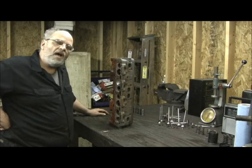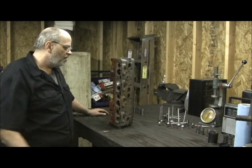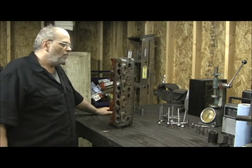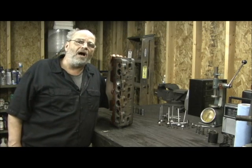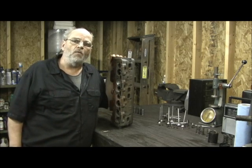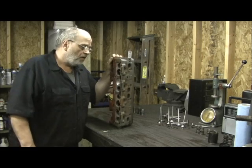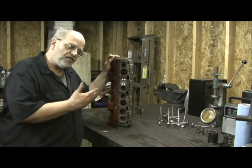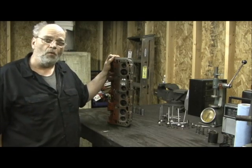He doesn't pull very often, every once in a while maybe a boat, but he wants a good dependable truck with some torque. I did match the cam — it's a head box profile. The cam was custom cut to match what I'm doing to the head so that it works with the computer and the check engine light doesn't come on. I'm going to go ahead and prep the head, get it ready for CC volume, and let you see what it was when I started and what it ends up with stage four work done to it.